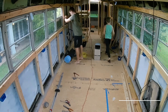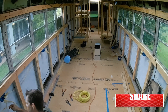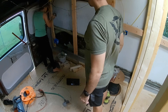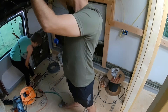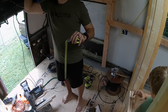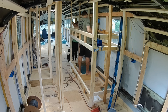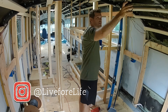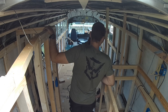Triton did all the knockouts — he measured the wires, cut them, and fished them through the back of all these outlets. This is rough wiring so we may end up changing things later. Here's the back of the bus running some more 12-volt plugs — we have some next to the bed. I'm gonna run a plug with a switch right on it so I can control some lighting in the bedroom itself. Also redoing the 12-volt wiring in the back bedroom — the lights for the bedroom, the bathroom, and the bunks are all going to share the same circuit, which is only six lights, so it shouldn't be a problem at four watts apiece.